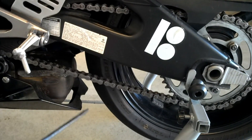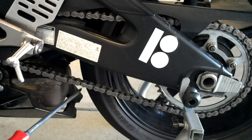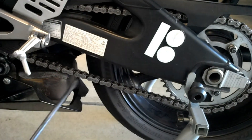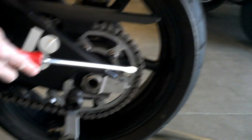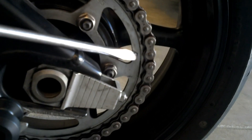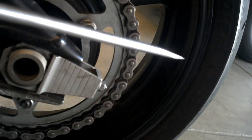See, it's starting to tighten up a little bit — now it's tight as hell and I'm having trouble turning the wheel. You can see it's real tight. His chain is stretched, the sprockets are worn out, and it needs to be addressed as soon as possible. See right here where the chain is going on the chain wheel — there's a gap right there and the chain is kind of falling and going in there. That's another thing you look for.